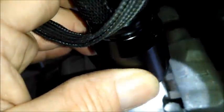There's my outer pad. Looks good. It's got a little taper to it, which is okay. That comes with the pad, that taper, but it's very thick. There's my inner pad, which is a little bit harder to see. Right there you can see the taper. That dark little spot there is the taper, but again it's got a lot. There's a better shot. Outer pad, rotor, inner pad is right there. You can see the backing plate. So that's good.